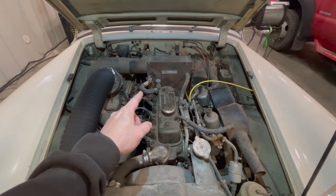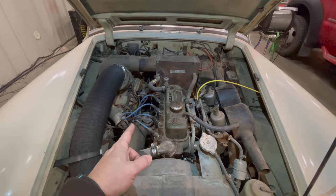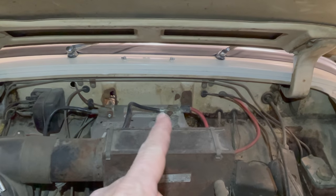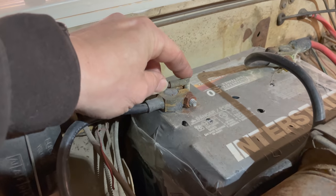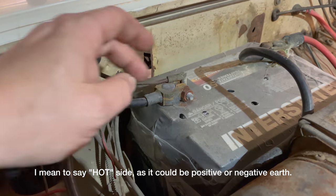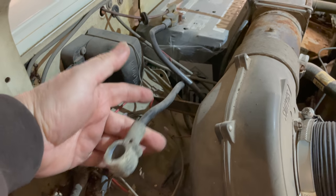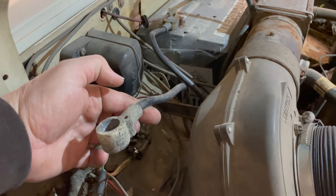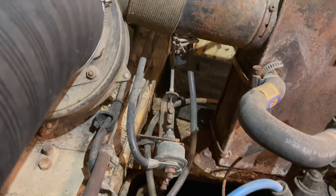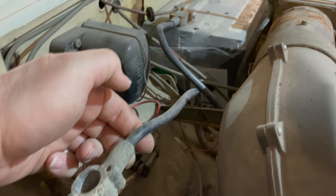You can see there's a new hose there running to the heater core. There are new clamps and a few parts on the hose that goes to the blower motor. Obviously the high tension leads and the throttle cable are not original. Back there you can see the typical corrosion made by the battery going through the firewall. Somebody has done something really weird here — they've taken the wire that needs to go to the positive side and just jammed it into the cable. I've never seen that before. The original battery cable is still here, so they put a new battery cable on it but left the original one. The original battery cable is held on by a clamp, so that must be why they left it in place. We need to remove one of these cables — we don't need both.